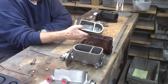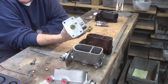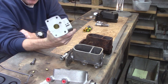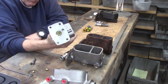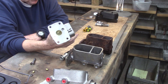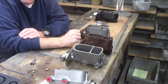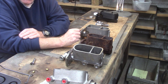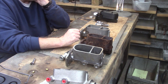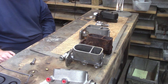People that are spending a thousand or twelve hundred dollars — it ought to be basically the finest work you can turn out; that's what I would expect. So we're not going to go through all this work and sleeve one from the beginning so that it never wears out and doesn't pit — that's why we go ahead and sleeve brand new cylinders too. These cars aren't driven, they sit a long time. You're supposed to be using DOT 3, maybe DOT 4, but DOT 3. It's hygroscopic — it collects water — and that's why the old manuals used to tell you to bleed your system and flush it out once a year, just like your cooling system. Of course, nobody's done that since the beginning of time.